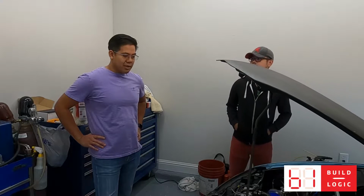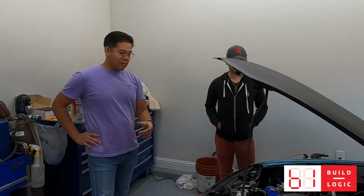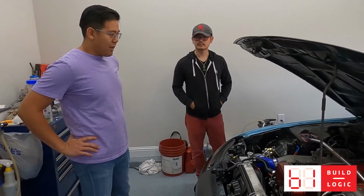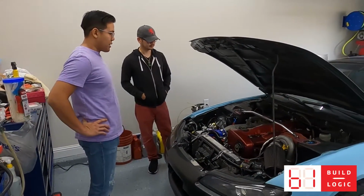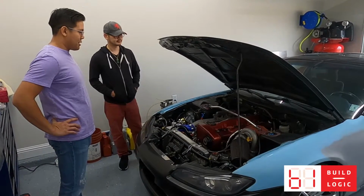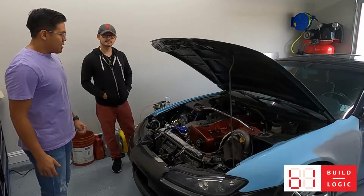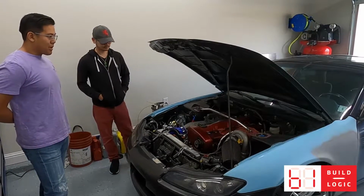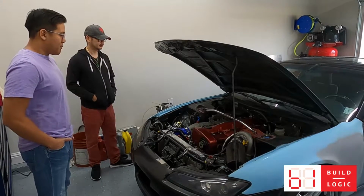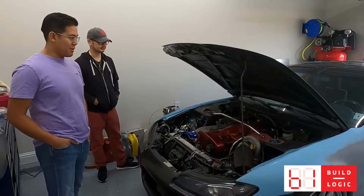And then I had some engine problems initially. So obviously that engine had to come out. This is still the same engine, but all the internals had to come out. And I chose to go ahead and stroke it with the Brian Crower kit. So now it's basically 2.85 in capacity. It's got a twin plate spec Super Twin or whatever they name it, but it should hold more torque than an RB26 should be allowed to make, really.